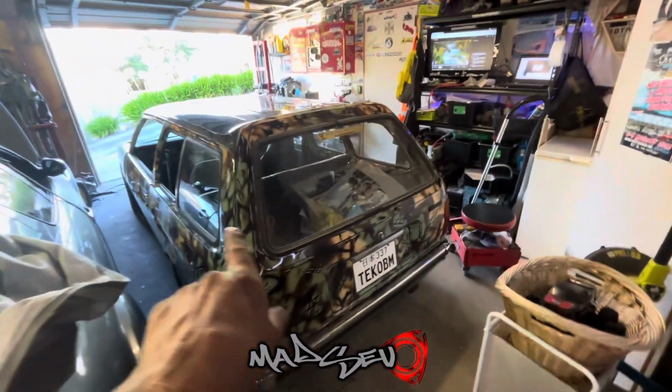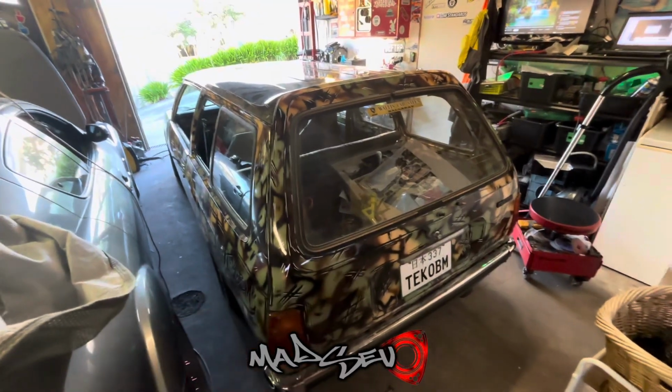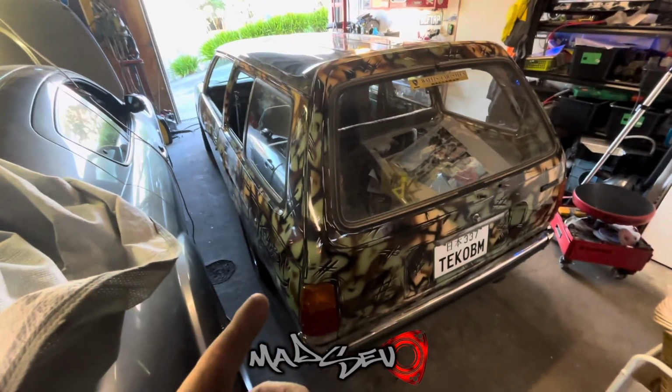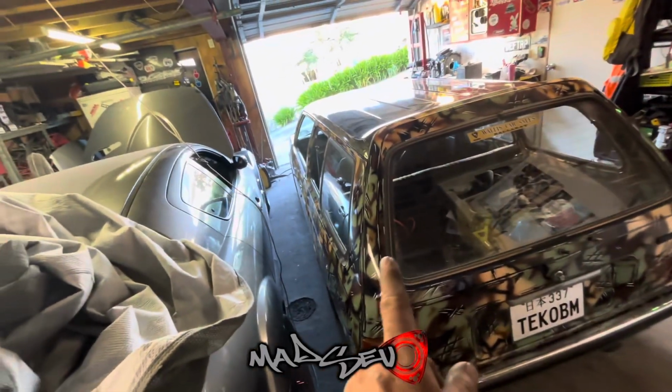Okay, tried to rebleed the brakes. Nothing's there. I've tried everything. There's no kink in the lines. Everything looked fine. There were no obvious leaks. So, master cylinder. So I'm going to go reach out tonight.